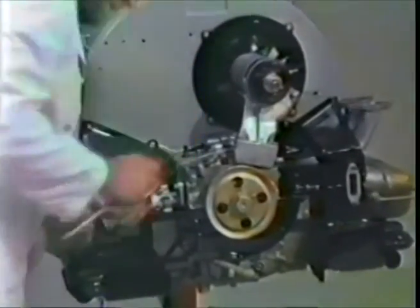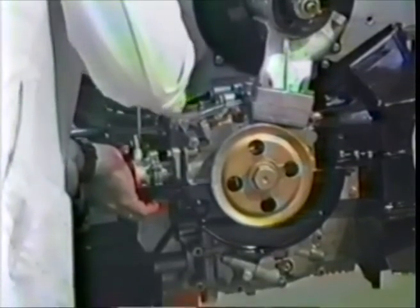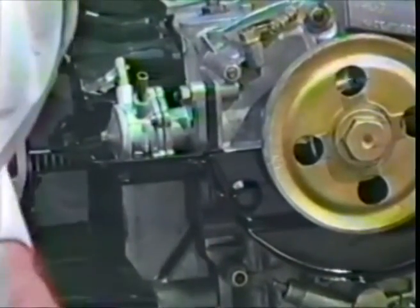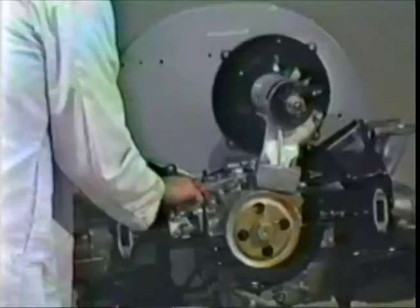Okay, let's get the dipstick shroud taken care of. This can be a real bear, or the fuel pump shroud taken care of. This is kind of hard to get to, but you put the screw down through the middle bracket or middle hole of the fuel pump shroud. You can then usually get the screw to take and go in. Sometimes it helps to take the other screws out of your hand to do this. And when you do that, you're usually rewarded by the screw actually going in place. I use a medium screwdriver to get the screws aligned in loosely, and then the big goody to really do it upright.